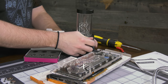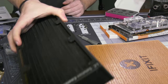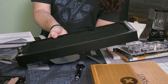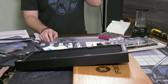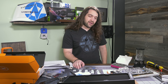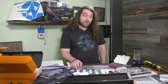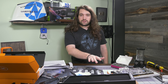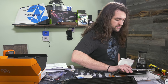Maybe if Linus starts begging as well — something he certainly is more skilled at — EK could use orange for him. He'll probably need the help. So we have the pump, a 360 radiator, and we'll use some really nice fans — 3000 RPM — it's gonna be super loud, very cool and efficient. Our limitation is actually going to be ambient temperature. So perhaps if it snows again, we'll set it up outside. Otherwise, there's the option of running the card off a riser for a negligible performance hit and then running the radiator in a tank, though that would require wrapping it in shop towel for condensation control.